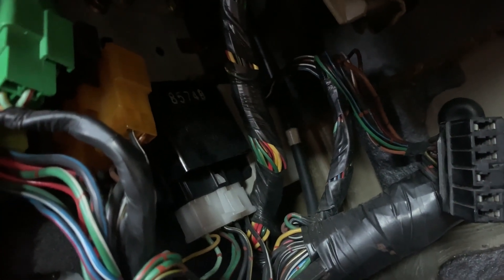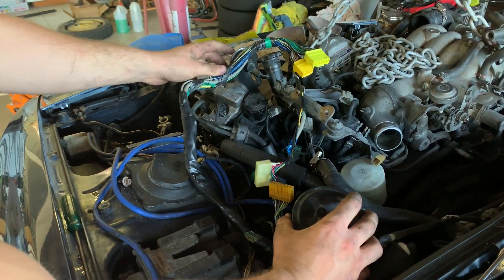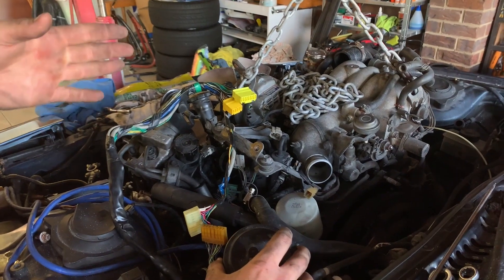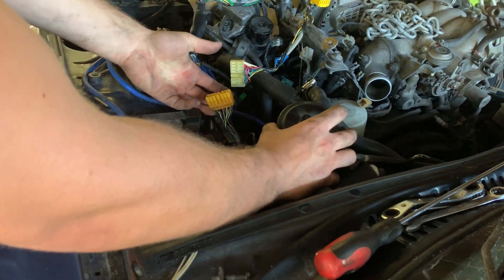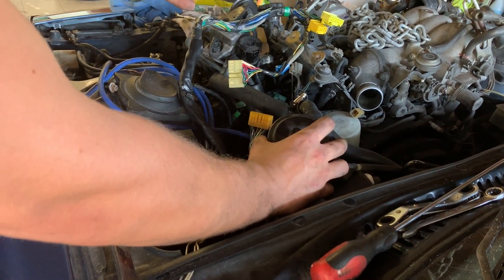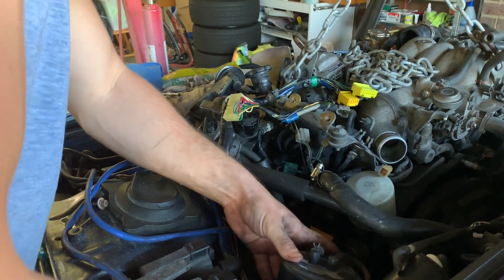So I've just disconnected the engine part of the ECU harness. There are another couple of plugs in this general area that have to be disconnected, and Dave's just pulled them through the firewall. We found a cool website - we'll put the link in the description - which has pretty clear instructions and we're not too far off the mark. It mentions two white connectors and two yellow for series fours; series fives have just two big yellow ones apparently. You have to move your charcoal canister to get to it, which is this big black thing here.